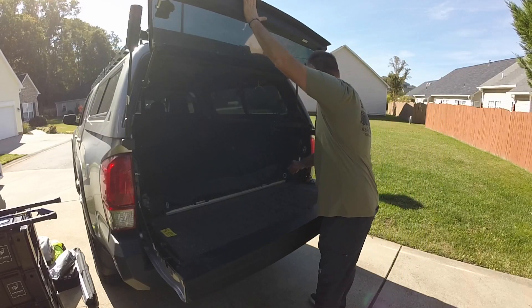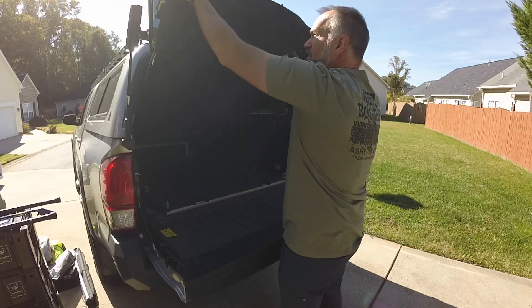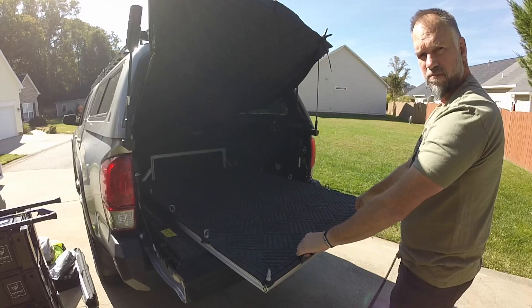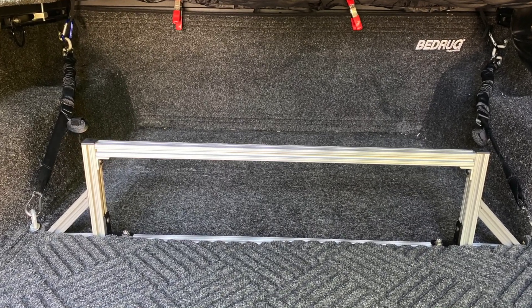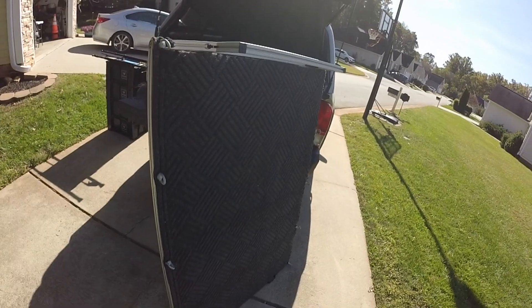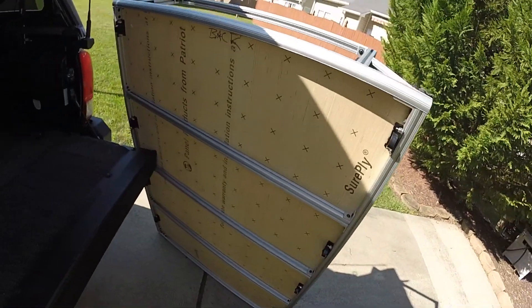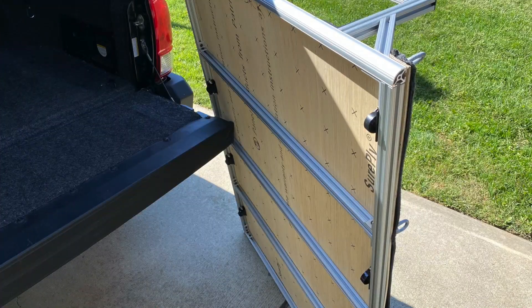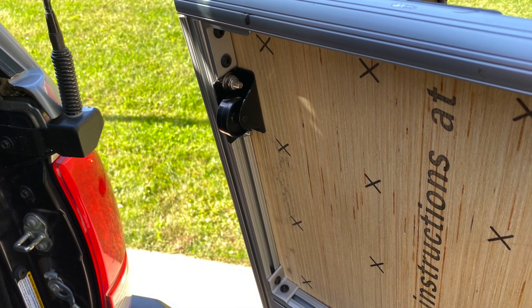This is just a poncho liner I use to cover up stuff in the back of the truck. As you can see, it slides out really easy. At the end I've got it attached with a couple of strap bits from Front Runner — I'll have a link in the description. Here's the bed slide taken out of the truck. The heaviest thing about it is the rubber mat; otherwise it's really light. I used quarter-inch plywood, and for the wheels I used caster wheels — I had to drill some holes in them to make them fit onto the 8020, but they work great.